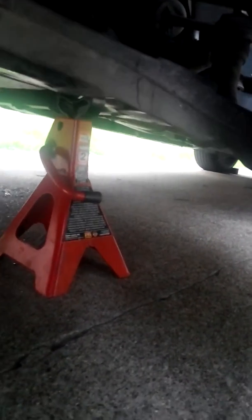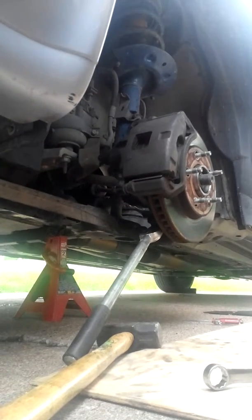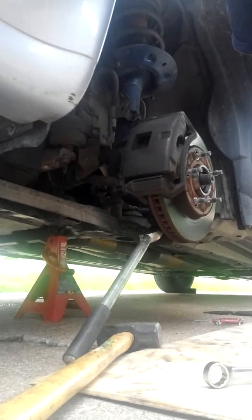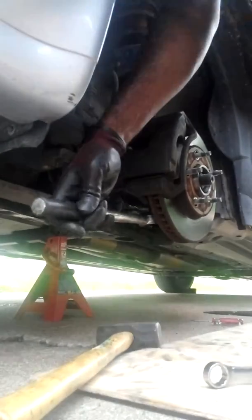That's how I'm going to knock it off — hit that a couple times. I got the two main bolts loose and nuts off. I got the castle nut off — it goes on top of this steering connection here. It's probably a 17, I think. I got that out of there — the castle nut, not a bolt. I got it loosened. So I'm going to take my pickle fork and ball peen hammer.